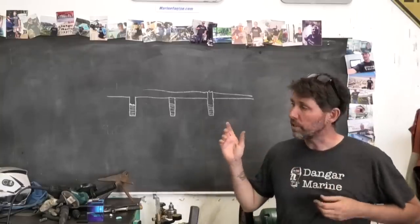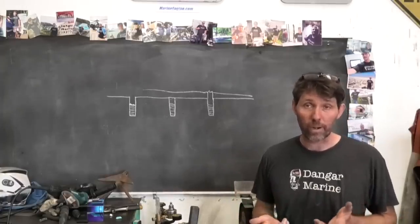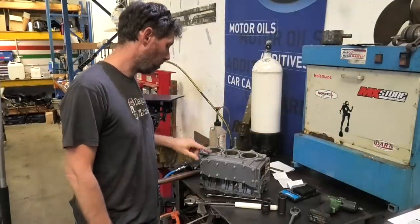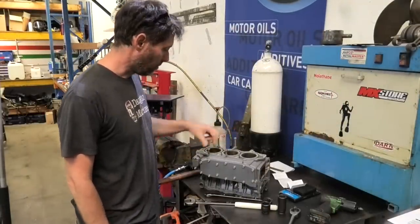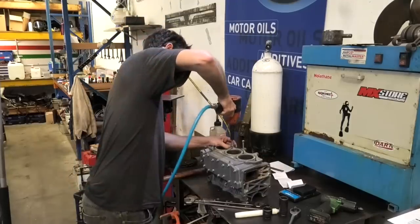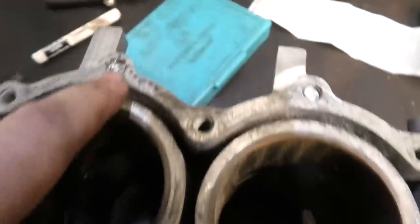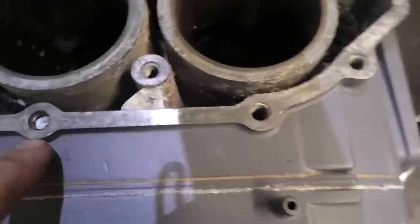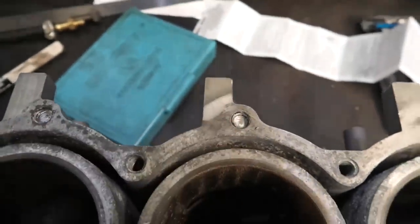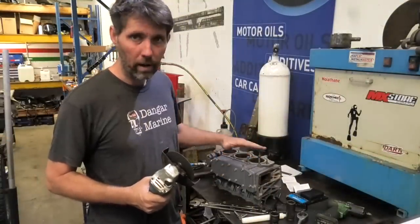For a few practical examples we'll go over to this engine block I've got here and I'm just going to crank the bolts up with an impact gun, see if we can get some of them to break, see how they break and then we'll get them back out. Got a variety of bolts here — some of them are high tensile, one I think is just ordinary, a couple from Marine. This bolt takes a different socket size but all the ones I could get the impact gun onto broke a couple of mil below the surface. These two I've tightened with the rattle gun but not enough to snap them — I'm going to cut one flush and then one higher up.